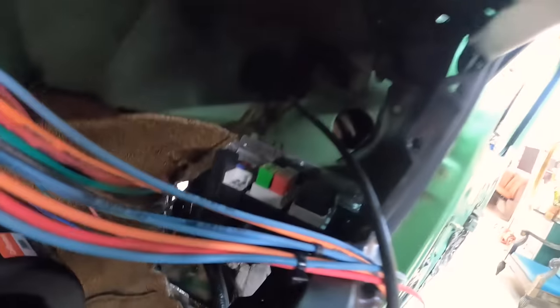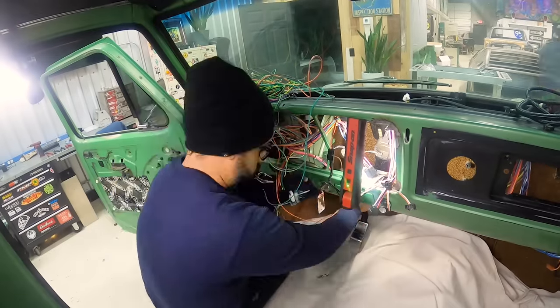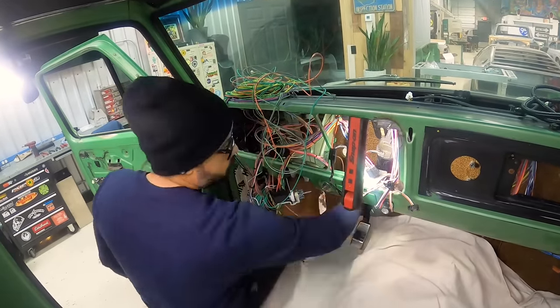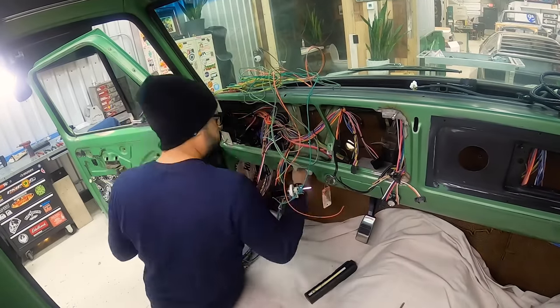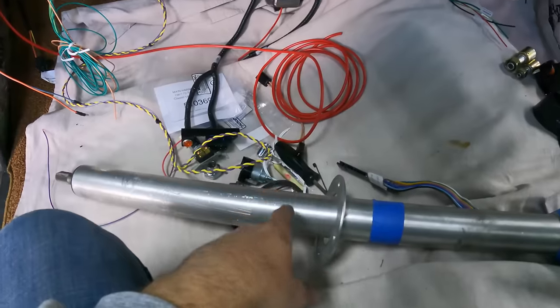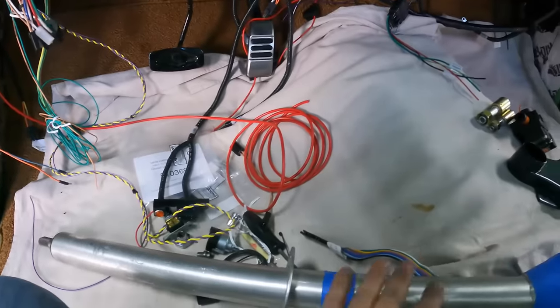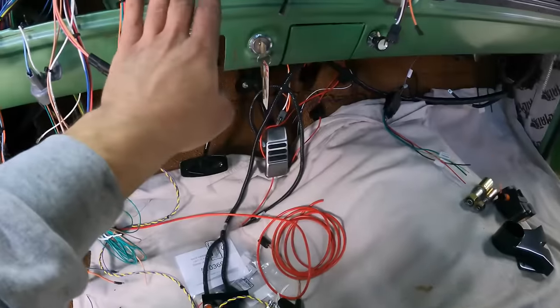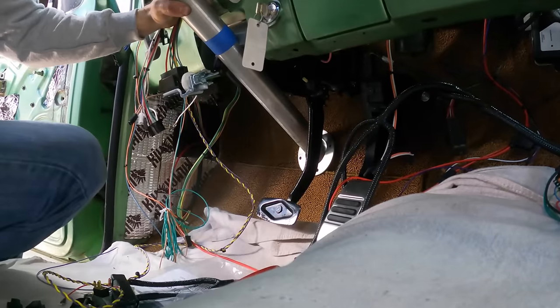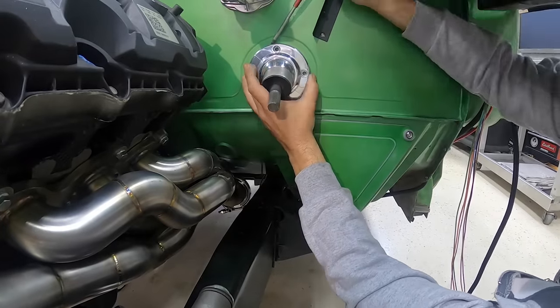The panel is mounted nice and tidy now. We're moving over to put in the brake pedal so we have that sensor in place. When wiring stuff, you want all your sensors positioned where you'll be able to make your connections, otherwise you're guessing where everything goes. To get a really good seating position, we're fitting up the steering column — this is a mock-up column — to set our steering linkage and measure where we want it to stop for the driving position.